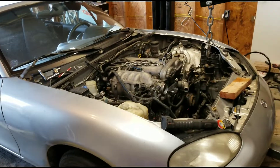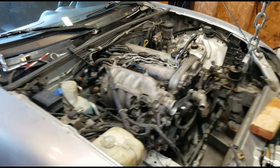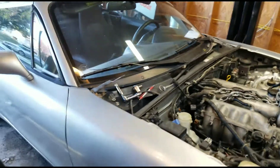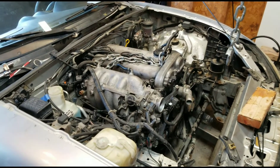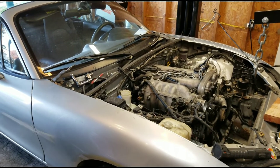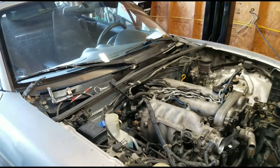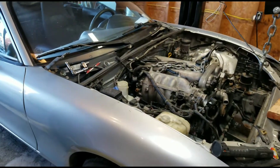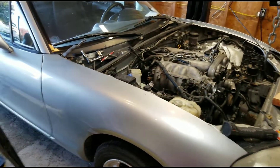The engine is back in the car. I apologize — my little time lapse idea did not work. I can sum it up for you though: fat guy struggles with an engine for about an hour. You've just got to lower it in, scoot it back. One thing when you're doing one of these: go ahead and remove that shifter — I left mine on the end of the transmission and it was a pain in the butt to get into the car. Next I'm going to throw this thing up onto the lift and reconnect that transmission to the I-beam that goes back to the rear end, and put the driveshaft back in. I need to refill the trans because I took all the fluids out when I pulled it. I need to get on this project though, because I've got the '67 now living outside while this is in here — don't want that going on for too long. This is definitely going to be an outside car.